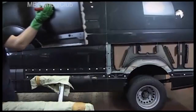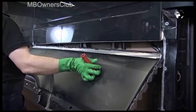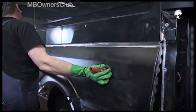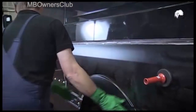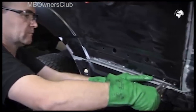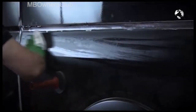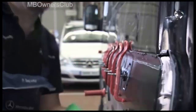Lift the prepared new part using magnetic grips and carefully fit it on the vehicle. When inserting the panel, ensure that you do not smear the adhesive. Use clamps to fix the bottom edge of the panel in place again. Then wipe the surface below the adhesive area and attach multiple trim strip clamps. Tighten these until the panel is cleanly and firmly positioned, but without bending it.